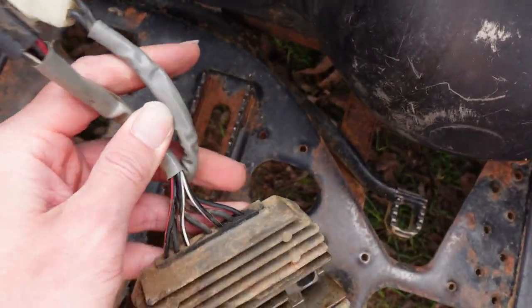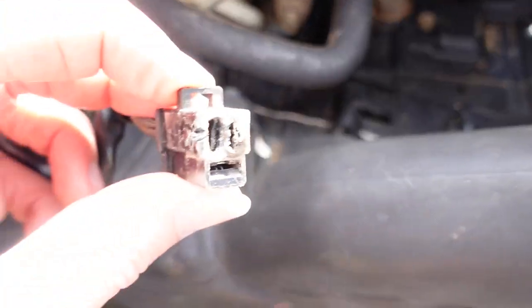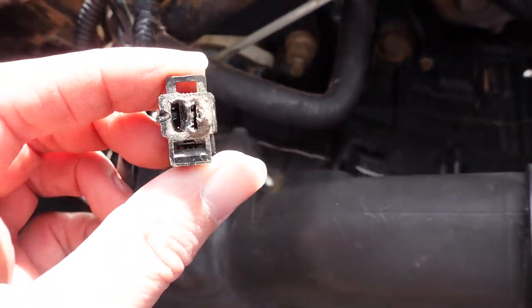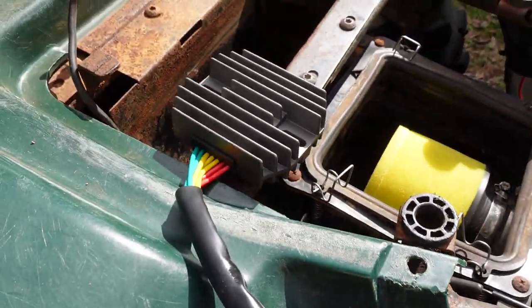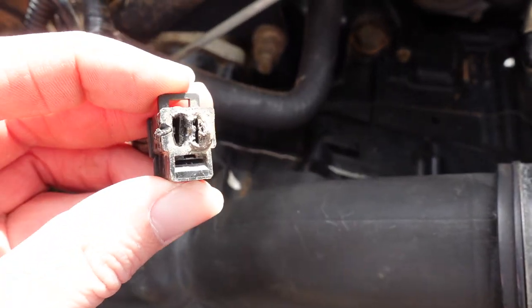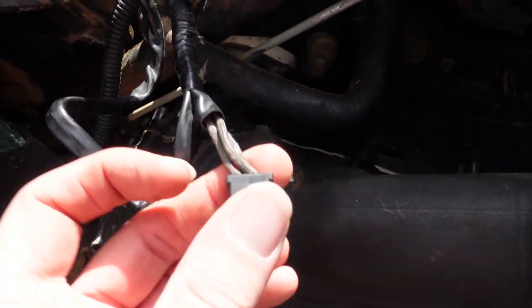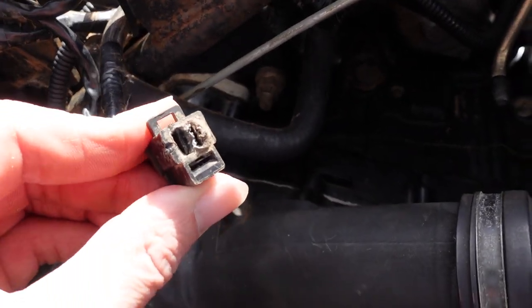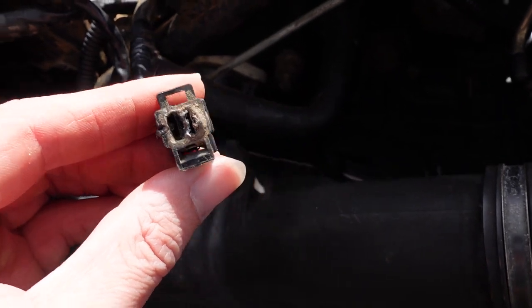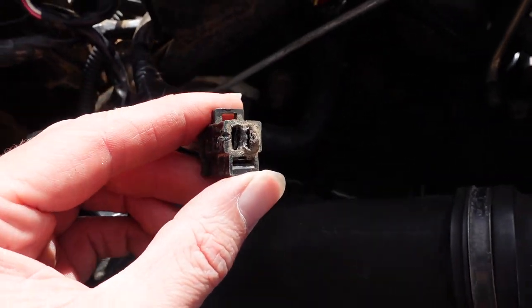I have the old rectifier off - it takes a minute to get it off of here. It looks like it's pretty much melted on the main wiring harness side of things. So hopefully we can get it to work with the new rectifier. But like Jonathan was just saying, it might have just got too hot and just the wrong voltage, and it's pretty much melted it. So hopefully I don't have to replace all of this. We're going to slap the new one on and see if it makes a difference. We've also had the battery on charge too, so we'll try to get back out there and see if it works.